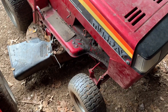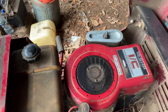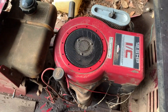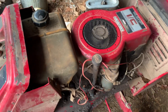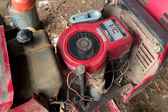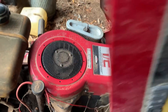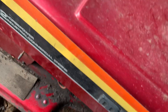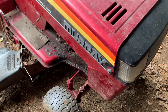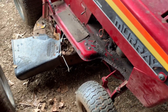This motor right here — we had one that had no sheet metal on it, that's what this motor was in. We mowed with it for years, then we got this one and put the motor in it. It's finally starting to get tired. I think I've got another starter I need to put on because it's got some chipped teeth and it doesn't spin as fast as it ought to, but it still starts and mows.